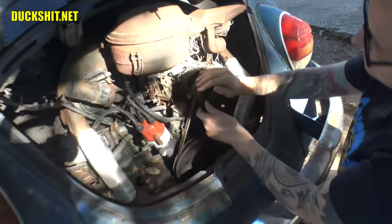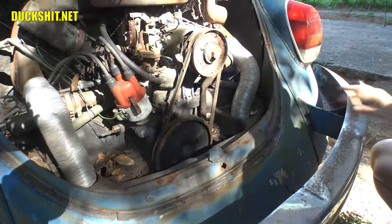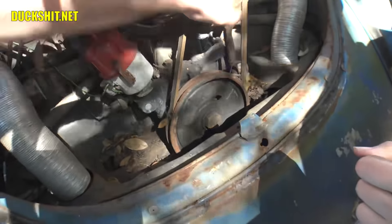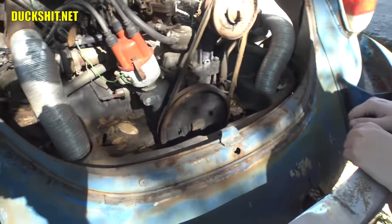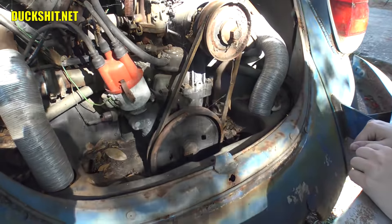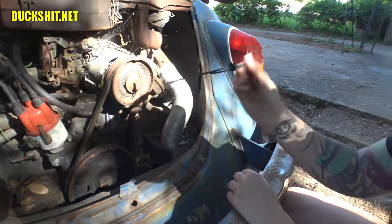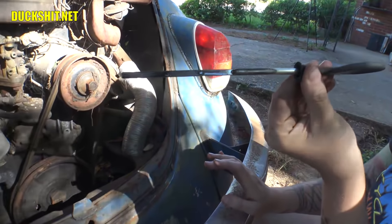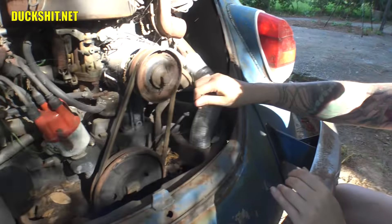Can you see if it turns over? We do have a loose engine — look at that. The engine's free. Yeah, the engine does turn — it'll take a little bit of force, but it looks like it does turn over. That's a good sign — complete revolution. This engine will probably start up, so we're going to make a separate video of that coming up in the near future: first start after almost 30 years of sitting. Ran when parked, right? It might actually be a good engine — I guess we're going to see. Check the oil. Pull that dipstick — what you got? Dirty oil, but is it up to the line? It looks like it's actually full of oil, maybe even just a little bit high. That's a good sign — that means the engine was probably taken care of. Ran when parked might actually be a good answer as to what it was.